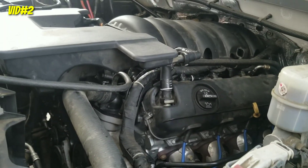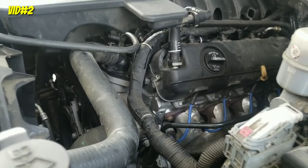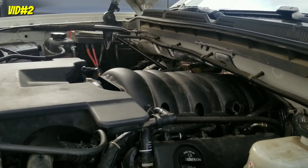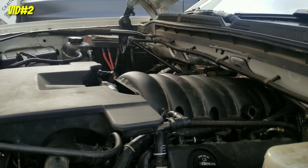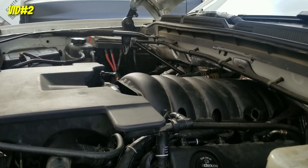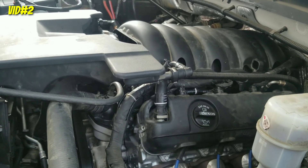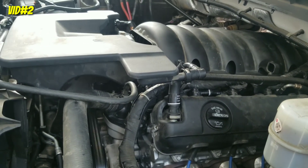The engine is running. With so little tools, anybody can get it done. All you need is a 15 millimeter socket, a medium socket for the exhaust manifold on the bottom, a 12 or 13 millimeter socket, an 8 millimeter, a 10 millimeter socket, an impact or ratchet, and a 13 millimeter and 12 millimeter open/box wrench so you can get the ground on the back. 11/16 or 17 millimeter to remove the fuel lines — that's pretty much all the tools you need.